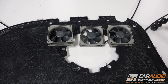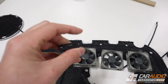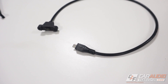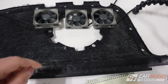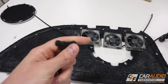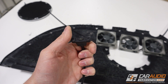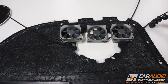It is going to be a bit of a tight fit, and I'm hoping I can pull this off because not only do I want to add these fans, I also want to add a micro USB port that will connect to the DSP. The idea is if I ever need to plug in and tune the DSP — which I do quite often — I don't want to have to remove this whole panel; I just want to simply plug in. But we don't want this showing because it's kind of ugly, so we want to hide it behind a small cover panel.